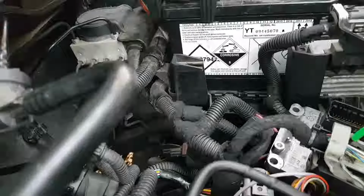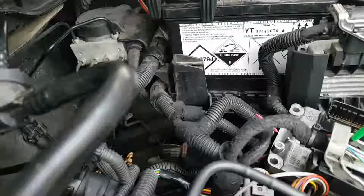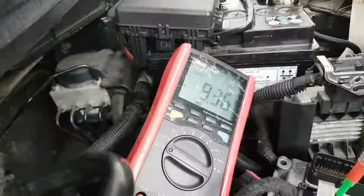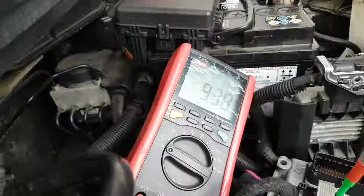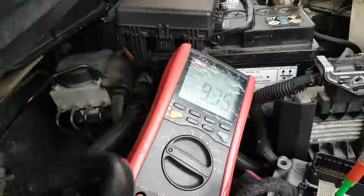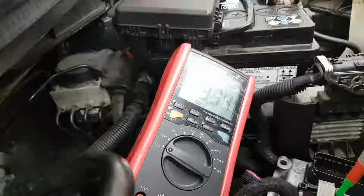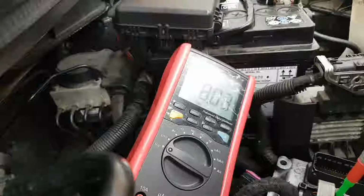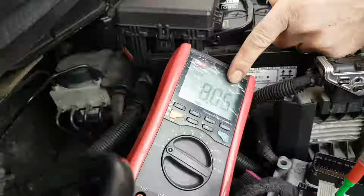And that also comes from fuse 20. Which one is fuse 20? Start fuse in there, number 10, 10 amps in there. Hold on a second. Let's see what happens when I pull that fuse, if my voltage drops. No, it doesn't. Oh yeah, it's now fuse 20. Definitely it's fuse 20. Fuse 20, that's it. Fuse 20 should feed those two wires. Look at my voltage. See that?